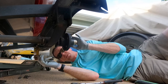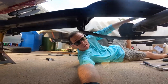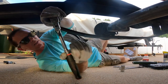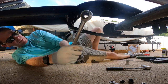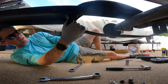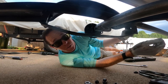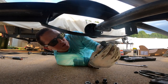Now that the u-bolts are loose, we'll put the floor jack underneath just to support the axle while we take out the leaf spring bolts. We're going to attack these bolts now — let's see if we can break this one loose. It's already kind of loose — isn't that great. It's a kind of weird, really small nut so let's try a double wrench. There we go. That one is loose. We're just going to leave it in there so it's not flopping around.